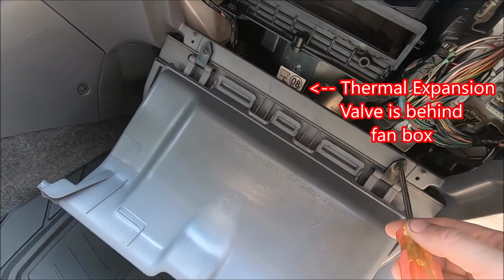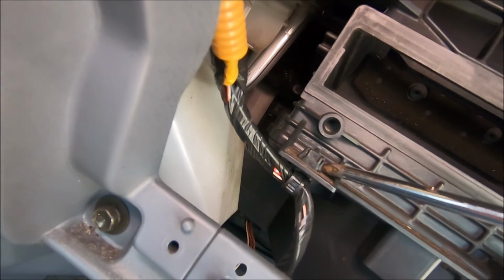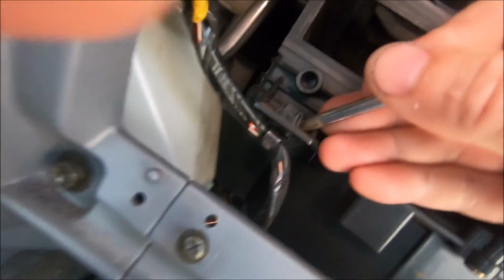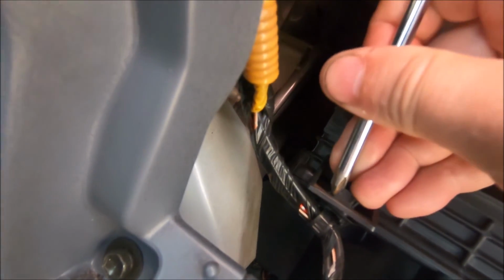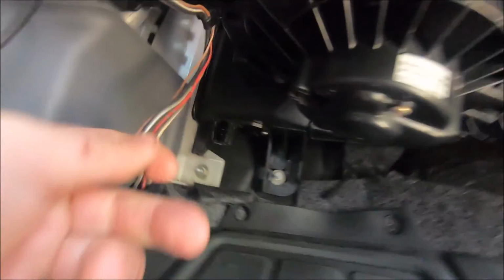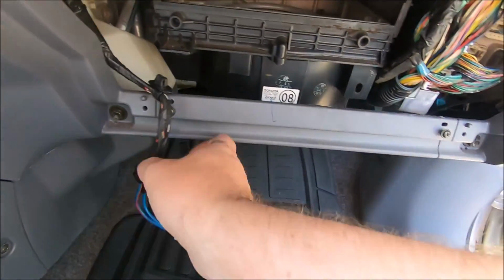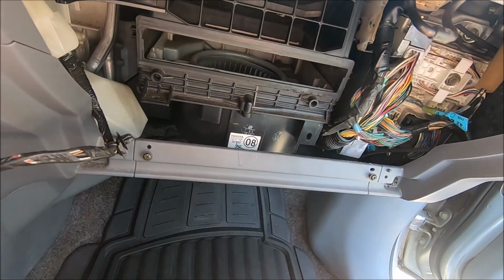So to pull the glove compartment, just these two screws and then it'll come out. You just need to pull this off the box. So that can be pulled away, and there's another plug down here. Okay, and this harness is free, and I'm just going to pull it over here for now, out of the way.